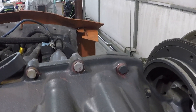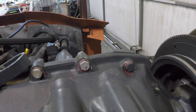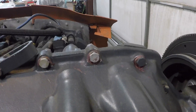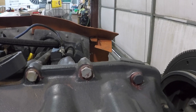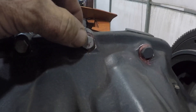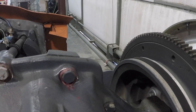But if you've got a top case leak and it's not leaking from the seam but from the bolt holes, here's the trick: take the bolts out, clean the holes very well with a wire brush, blow them clean with carb cleaner, brake cleaner, or some solvent to remove all the grease. Then come back with low-adhesion fuel tank sealant, mix it up, push it through the holes wet, put the bolts through wet, clean off the threads, and nut it — and you'll have a dry case.